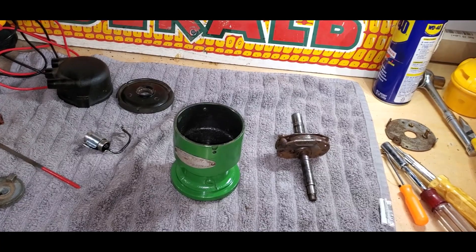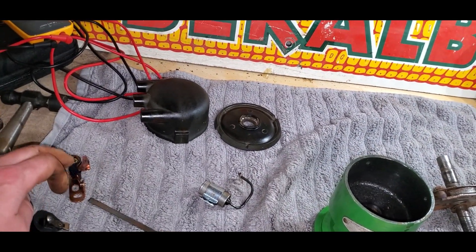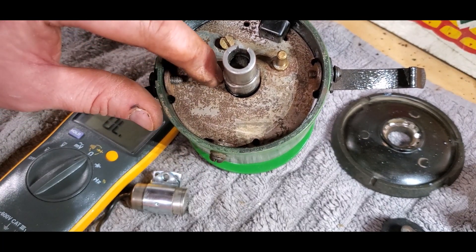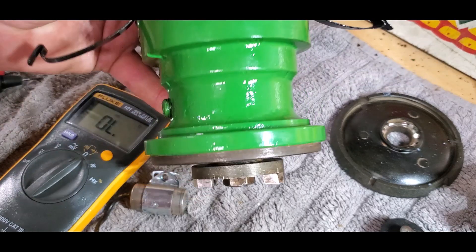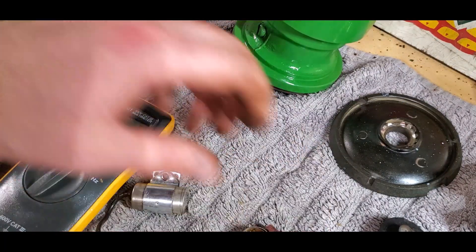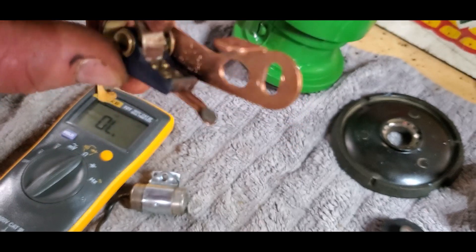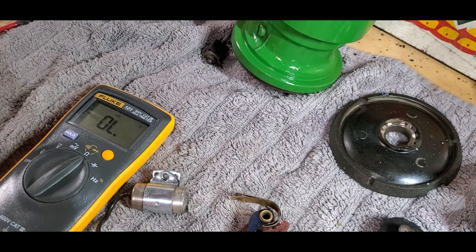Here we are a day later. I've got the housing all painted and cleaned up — now it's just time for some assembly. I'll test the points and the condenser before I put everything back in. I've got the distributor put back together, reassembled, and lubed everything including the ignition advance mechanism down beneath here. Everything spins nice and freely. Before I put the points and the condenser back on, I'm going to check those. Here are my points — the condition of them looks actually in really good shape. The point surfaces are nice and clean, so I don't question the condition of the points.